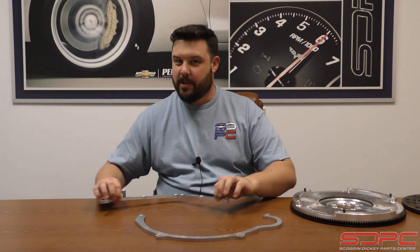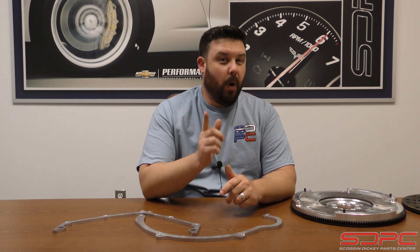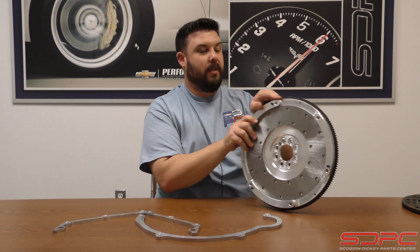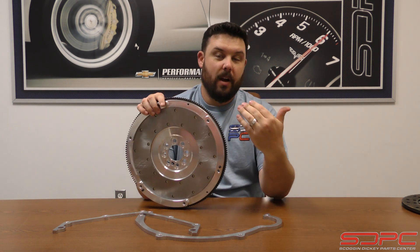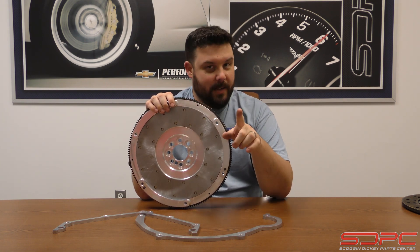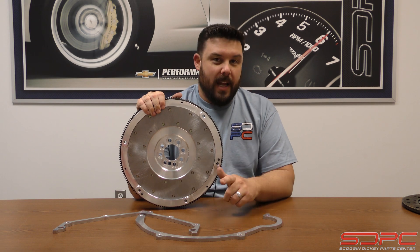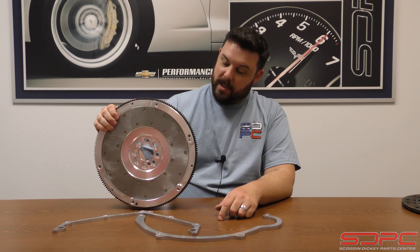One more tip I'm going to give you — this is actually for a project we have, specifically Dane's. I stole it from him again just like I did in one of the last videos; he's nice though and he keeps letting me. If you're looking for a nice inexpensive clutch option for a Gen 5 LT and you're not looking at a big shot of nitrous or big boost — keeping it below kind of the 500-ish horsepower mark — one thing you can do is call us and get one of these flywheels made by RAM. If you do get our LS7 clutch kits, you can opt for an aluminum RAM flywheel. And if you're running a T56 behind a 4.3 or a 5.3, you can actually run that LS7 clutch using this flywheel here.